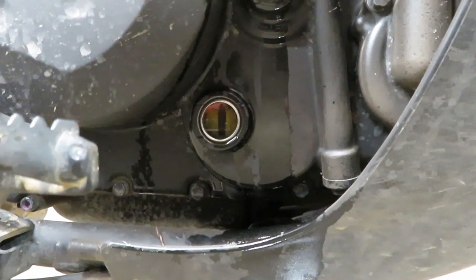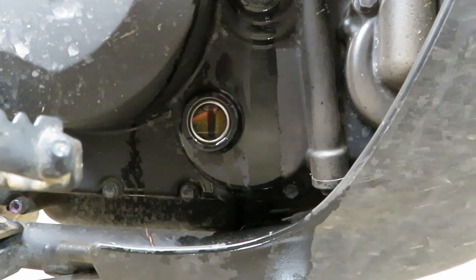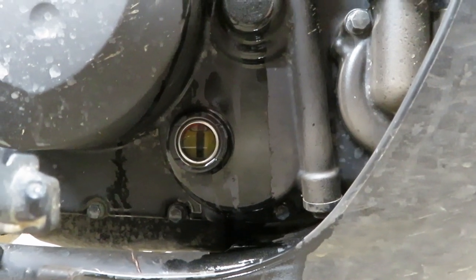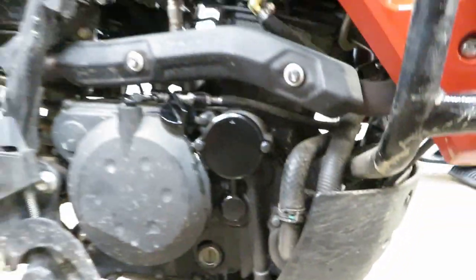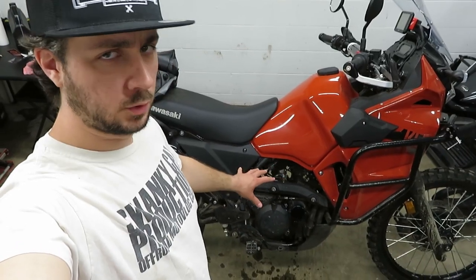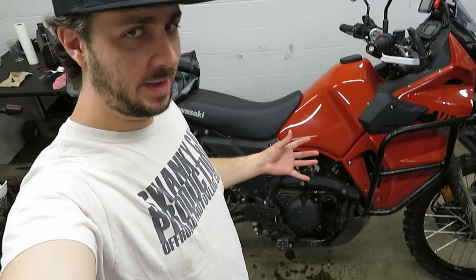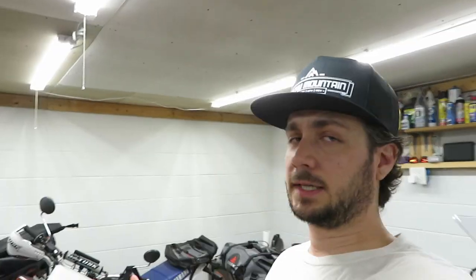There's a lot in there but I think we'll be okay — just a little bubble at the top. Of course you need to push a little into the oil pump and the filter, so I'll double-check the level later. I'll go through and clean up all the residual oil on the motor so that if I spot any oil later I'll know it's new oil and not old.